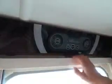To switch your 12-volt systems on and off, just press that button — that turns all your 12-volt systems off, press it again and it switches it all on. Even when you're on mains you still need to switch that on, as it still controls those systems.